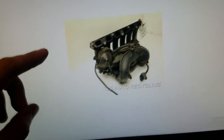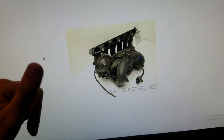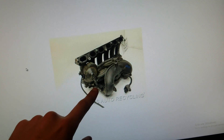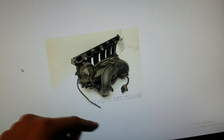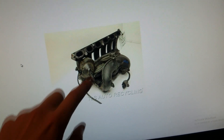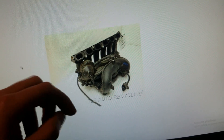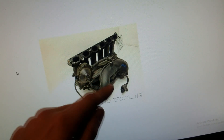Here's the difference: early 2005 cars and up to about mid-2006 will have a manifold with a single port, as opposed to the two-port manifold. If you have a 325i and you get a single-port intake manifold and you get a three-stage manifold, ideally you want the manifold with the single port because it will be plug-and-play — you don't have to deal with the hose and all that.